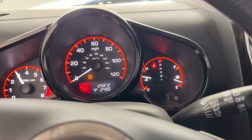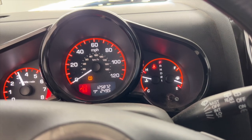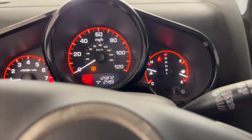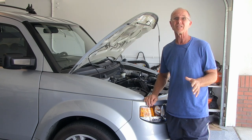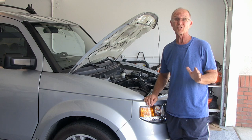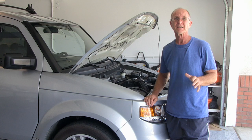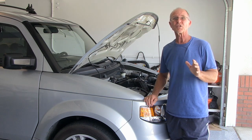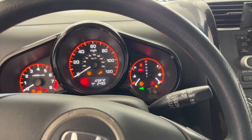It has a little air bubble in there somewhere, so I'm going to go ahead and shut it down. Having an air pocket in your cooling system is pretty common after you change the coolant — that's why I watch the temperature gauge very closely. If your temperature starts climbing, shut the engine off and let it cool down. Then start it back up and let it run again. Sometimes it's going to take a few times. It's cooled down, so let's give it another try.